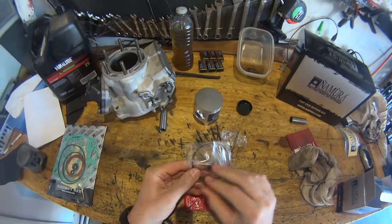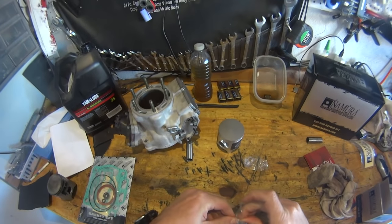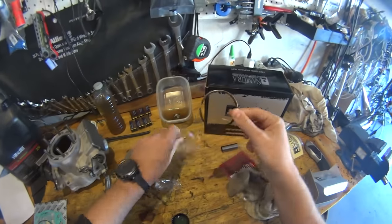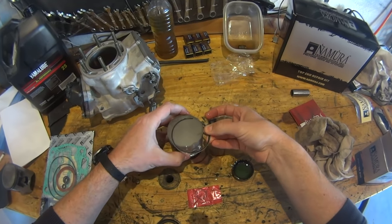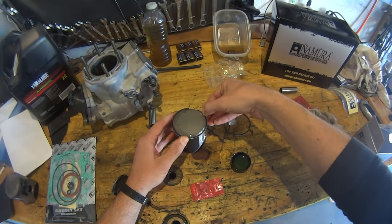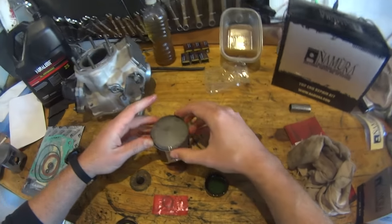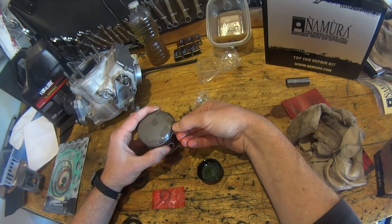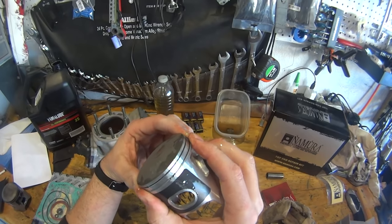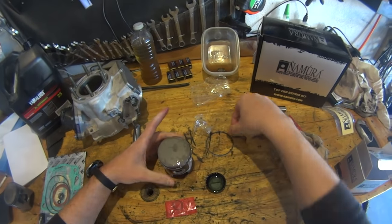To lubricate things, I've decided to use the two-stroke oil that comes with the oil you put in the gas. The power valve and everything is adjusted already, so I cleaned it. Now it's just time to put the rings on top of the piston. You have to start at the bottom one first. I start from the back over here, then just go over and let it go into the channel, then go from the other side and pull on it - not too hard to bend it, but not too little. The piston ring is in and it has to align with the pinhole. It has to have free movement - it says in the manual it has to have free movement. That's very, very important.